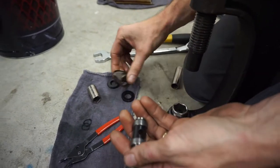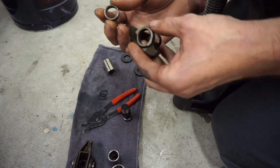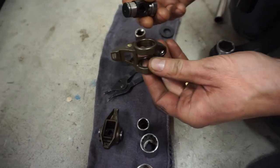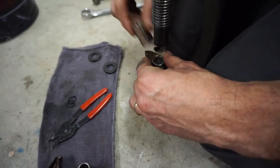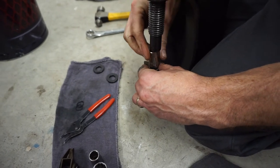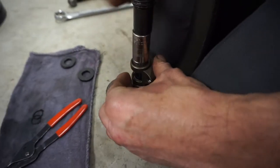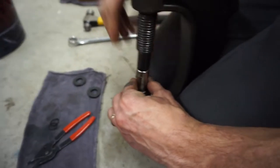First, make sure nothing is in the way. Get your new trunnion, put one side in first, take it down till it bottoms out, and slide through. Press the top one in. Normally you'd use a hydraulic press with a ram that cranks down — you don't have all these crazy contraptions fighting you.